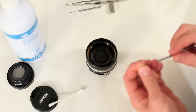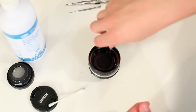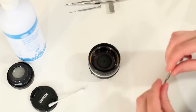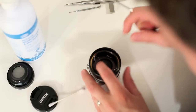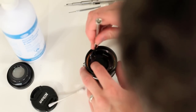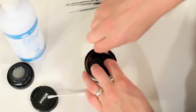This is my trusty screwdriver - I use it for everything and it's just worn right out. A tip: you can magnetize your screwdriver by banging a magnet - whack, whack, whack on the end - and it'll jump the magnetism onto your screwdriver so your screws just stay on. Now I don't tighten those screws yet. You can see I can rotate the aperture - we're going to go until it butts up to the old glue, just goes right up to it. Holding it, we just tighten these screws and everything will be tickety-boo. Give it a good tightening - not too tight, actually. Don't do it too tight or some of you will strip it.